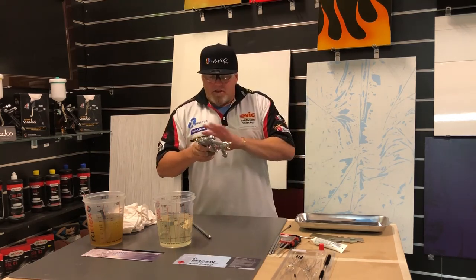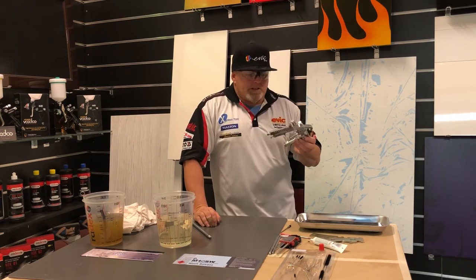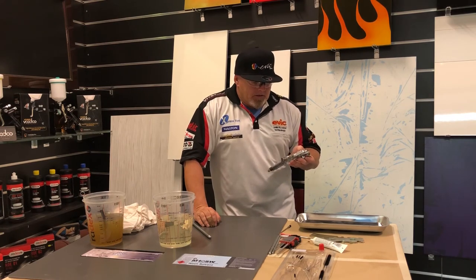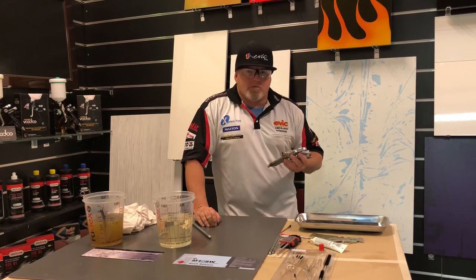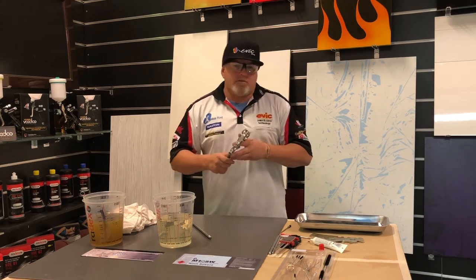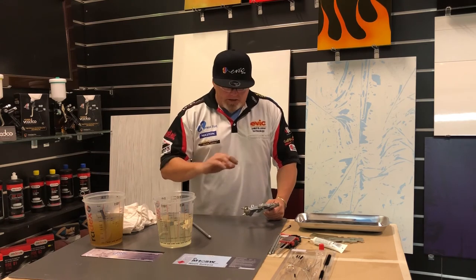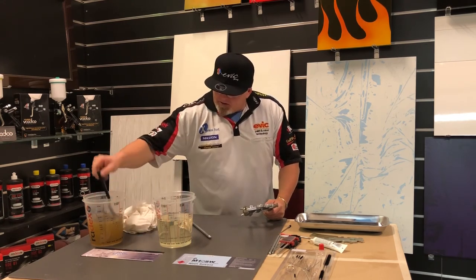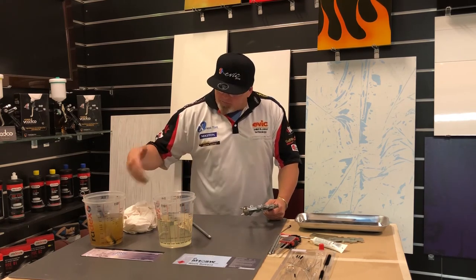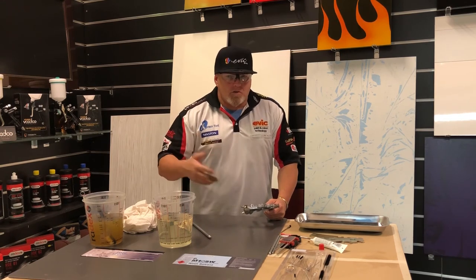So that's pretty much it. Everything was done with soft hands because these guns aren't like a jackhammer — you've got to take a soft approach. The cleaning product does all the hard work, as you saw before. Because we were filming this video I rushed it a bit, but normally I let them sit for about 15 minutes, then come back and lightly give them a tickle with the tools from the cleaning kit. That helps break all the residue off, and then you just go through the process.